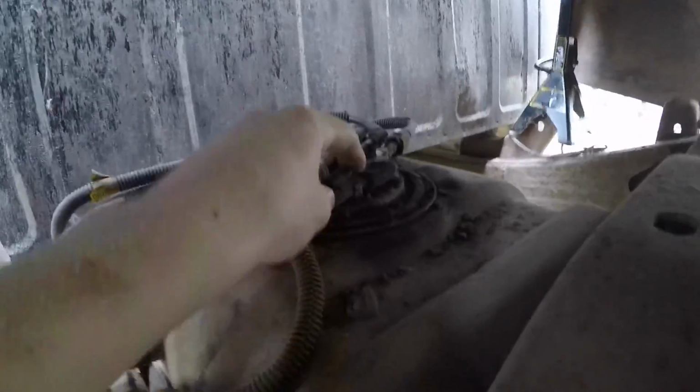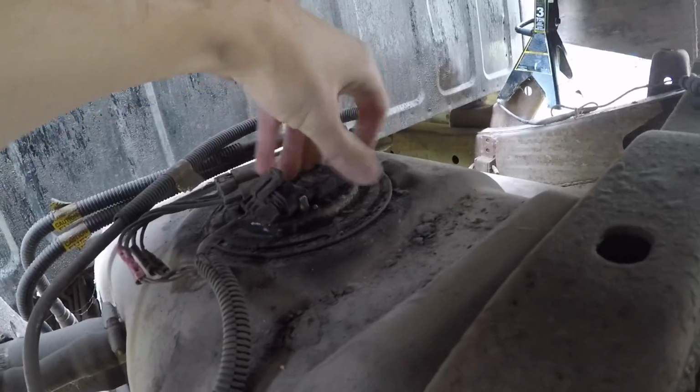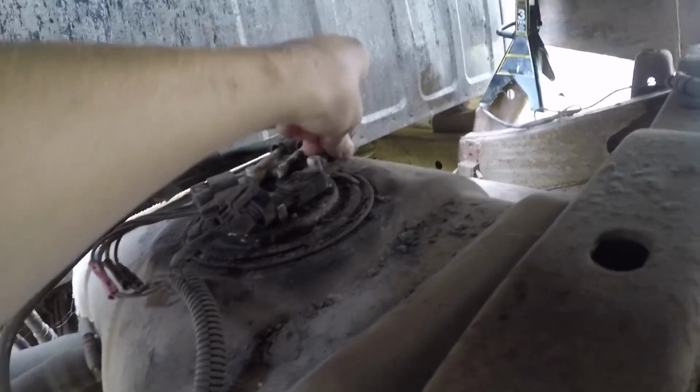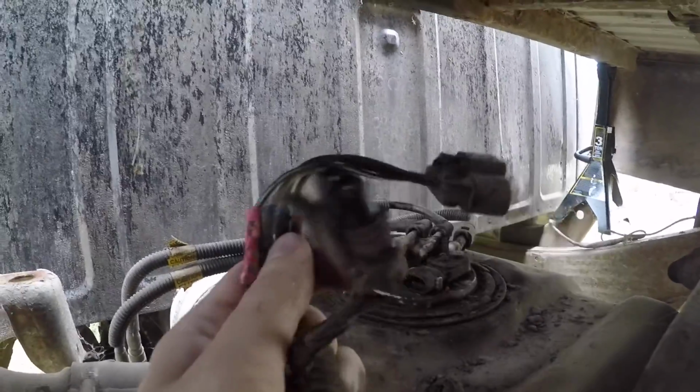And then we'll come right under here, unplug the clip on this side, the harness, and then do the same with the other side. So your connector may look a bit different. This one's been spliced in, as you can see, and crimped on. That's how you should do the new connector there. It comes with good directions, but there's just a little tab you've got to pull out to release this side.